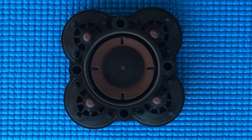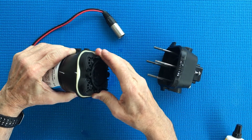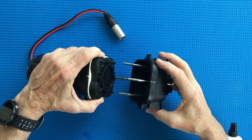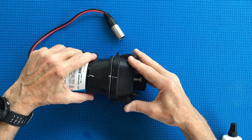Position the new valve block with the center diaphragm facing up, over the wobble plate seal, making sure it seats properly. Using the reference marks you made earlier, align the pump's upper housing, lower housing, and motor. Loosely tighten the four bolts.